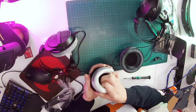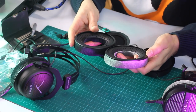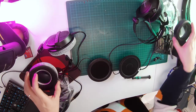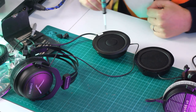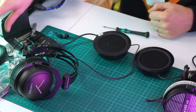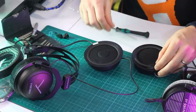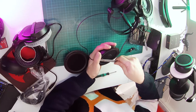The pads — I think these are basically the same pads, just the black version, black velour. They've got the same foam inside, the same holes underneath. So pads are pretty much the same, just a different colour. But underneath you can see this has just got some felt, whereas this has got something more advanced — a sponge disc with a thicker bit in the centre, over the centre of the driver, which will have been used to tune them. I recently had the new DT 900s and they had a similar kind of thing going on.